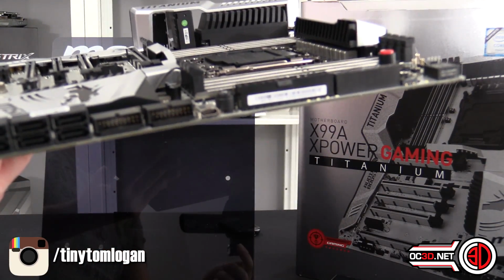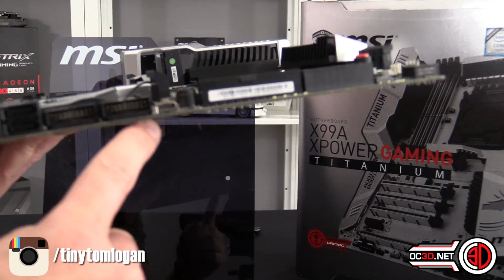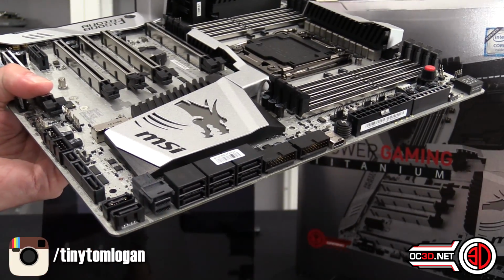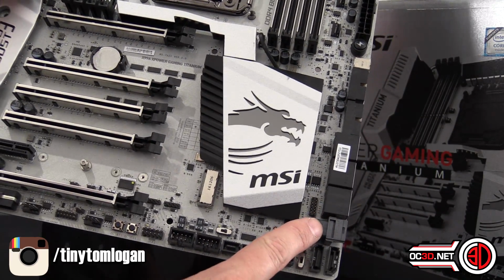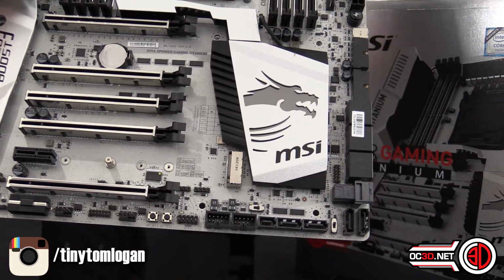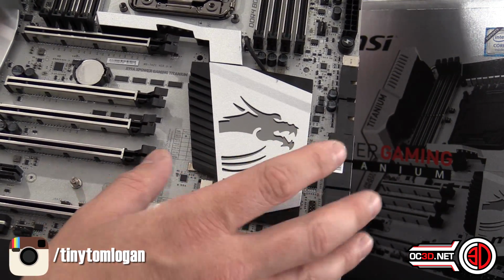We've got an internal USB 3C up here. Then we've got SATA down here and a U.2, so this is for your super fast, we'll say solid state drives, but this actually does share the same bandwidth as the M.2 because they both run on 32 gigabits a second. It's 4 PCI Express lanes, so that's where that comes from.